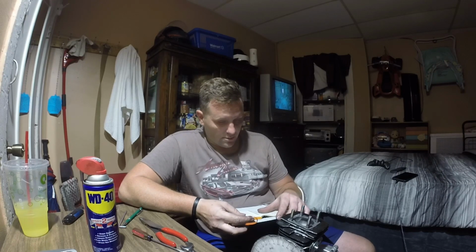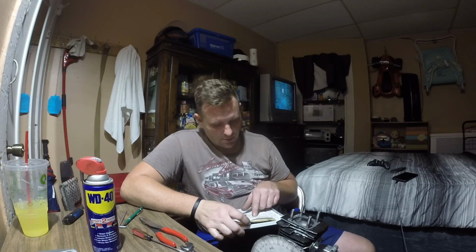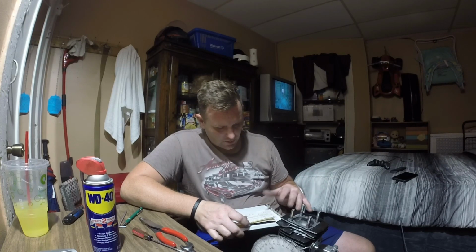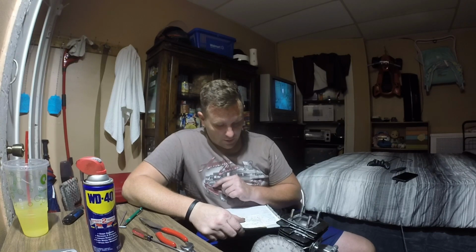The blowdown, we got 27 degrees of blowdown. It was 26 degrees of blowdown on the other bottom end, which it ran good, but I'm not a huge fan of that much blowdown. So what does that mean? I don't know. It means I'm not happy with the intake. It means I'm not happy with the transfers. I'm only happy with the exhaust.